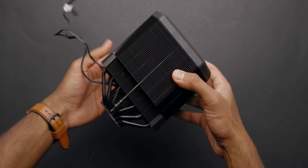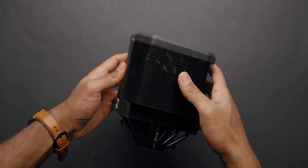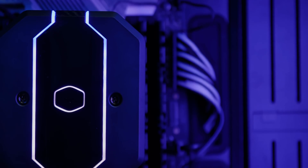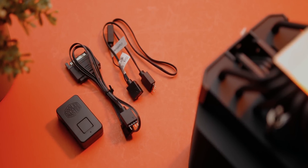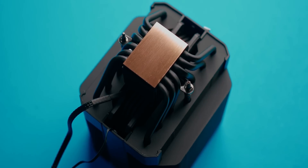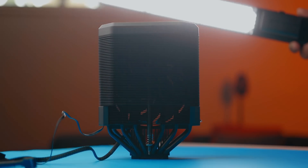What makes this mini Wraith Ripper special? First of all, it's the looks. From every single angle it looks like a clean black monolith — blacked out with no visible fans and a super dense fin array. Personally I think it looks great in an underrated way, and if you want some bling, there's that too. There are two thin lines of addressable LEDs and the outline of Cooler Master's logo, controllable with RGB software from Asus and others provided there's a 5-volt header on your motherboard. For older systems, there's an included controller that plugs into a SATA power connector and lets you cycle through preset colors and effects. From a technical standpoint, this cooler has six continuous heat pipes that make their way up into two individual fin arrays, with a single 120mm fan completely hidden away by the plastic shrouds. The closed sides supposedly help direct airflow, though I have some doubts since they're exactly the same size as the fan.